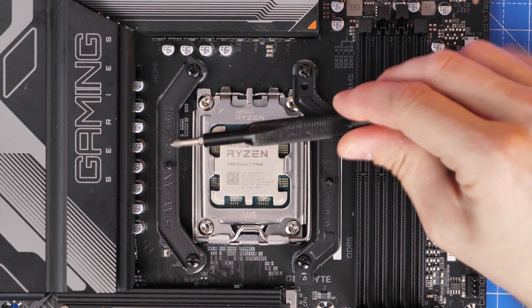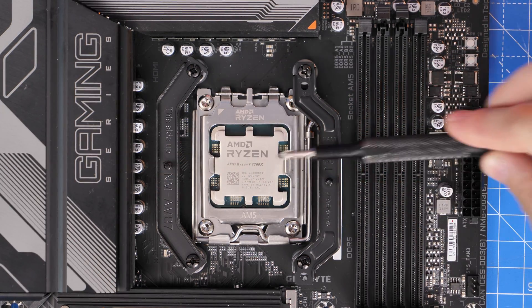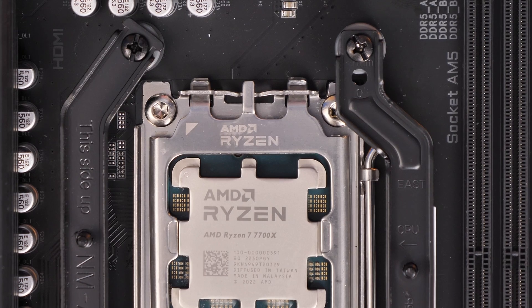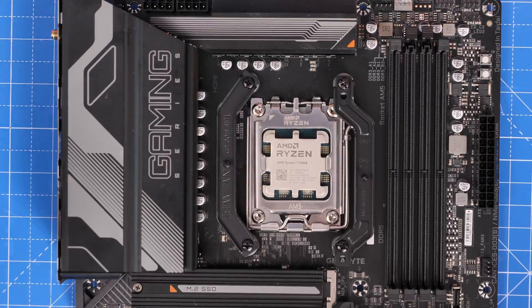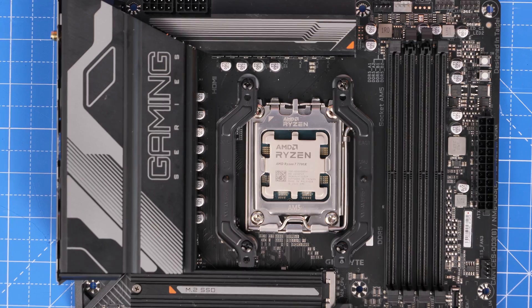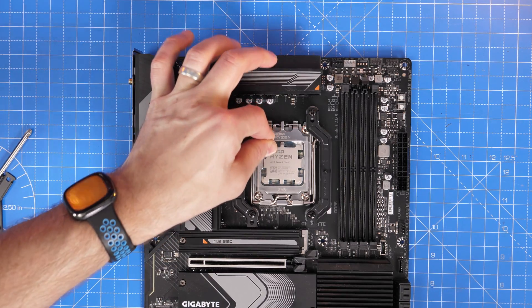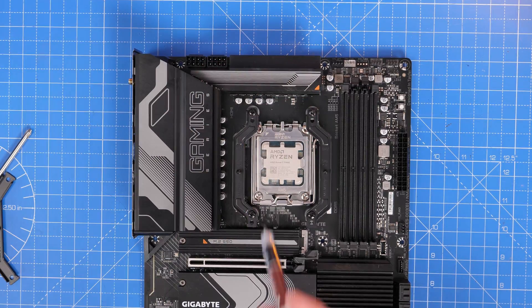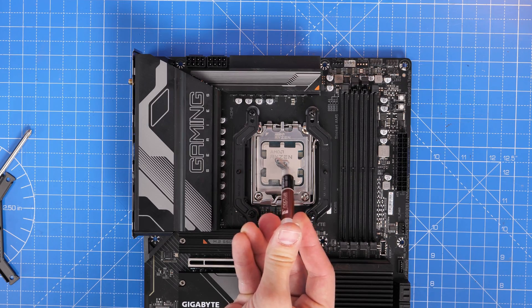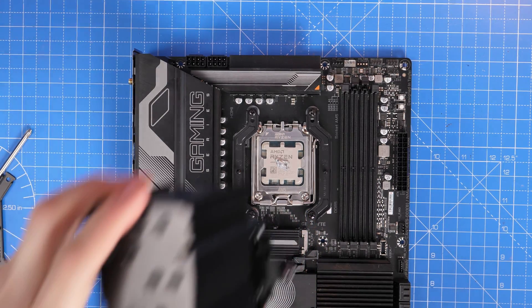If you put them side by side you'll see the new ones on the right and the standard one on the left — you can clearly see the difference. You'll also notice markings with a CPU arrow indicating where the CPU needs to be, so you can't put them on the wrong way — just pay attention to the labeling on the brackets to get them correctly seated. Repeat the process on both sides, secure the new brackets down, then apply the thermal paste guard, apply thermal paste to the center of the CPU, and seat the cooler down over the top, securing it in the standard way.